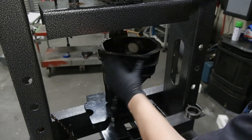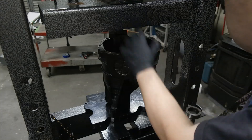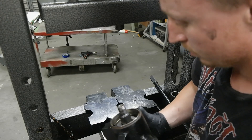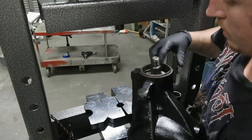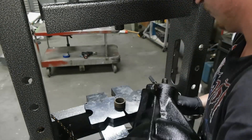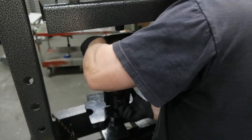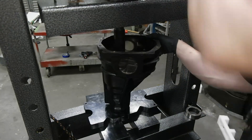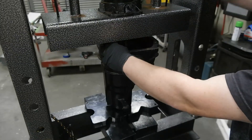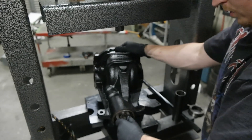It's starting to bind up now — it's grabbing on the casing. Now I need to space the other side up a bit more. We can see the bearing is partially pressed on. The problem is there's a gap here, so I need to put a spacer there to continue pressing. There we are — installed. Not binding up.